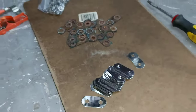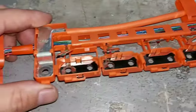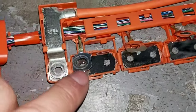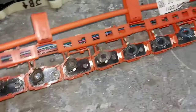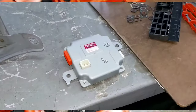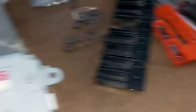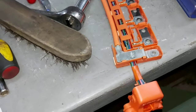We've successfully changed all the bus bars and cleaned the voltage sensing monitor connectors with a piece of cloth and vinegar to remove all corrosion. Now let's assemble it back. Before assembling the battery management unit, note that the management unit has a connection directly to the high voltage through these cables. I've had many cases of vehicles not starting because there's no signal from the battery to the BMU — usually due to corrosion on the pins.